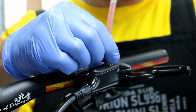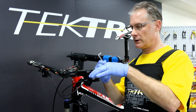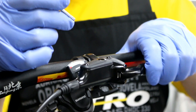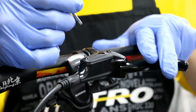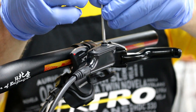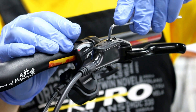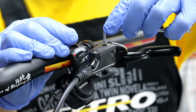Take off the injector from the lever. Before installing the bleed port, let's check modulation to confirm that there are no bubbles left in the system. Then go ahead and reinstall the lever bleed port, making sure this is very light torque, between 0.8 to 1.2 Newton meters.